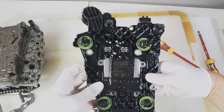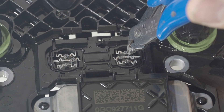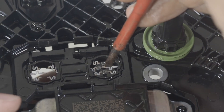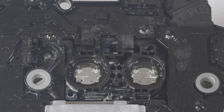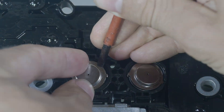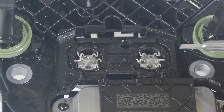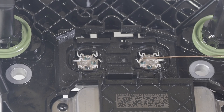There we got the two sensors we wanted to replace. This is the exciting bit where we cut the sensors out. First sensor out. Second sensor — the sensors look quite similar. Here on the left is the old one and on the right is the new one. The old one has a slightly different part number and the coloring is quite different as well. I could move the connectors quite close to the pins on the bottom and top ones, but the ones in the middle have quite a gap and I hope I can use a little bit of copper wire to connect those.